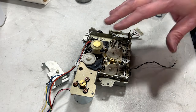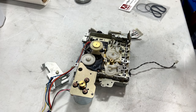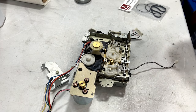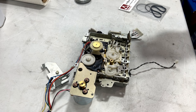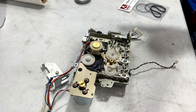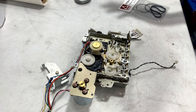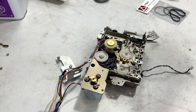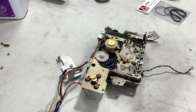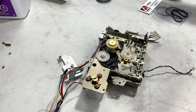And before we really get into this, I wanted to let you know that I have transistors coming for the tuner on this AW-1. I'm going to make one attempt and one attempt only to get that tuner working, and we'll see if we can do it. And yes, it has occurred to me that maybe there was something else pulling down that B-plus rail to the tuner, but if there is, I can't find it. I've tested everything in that circuit.